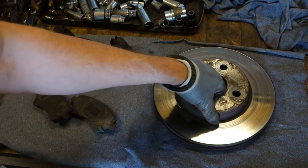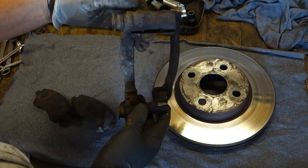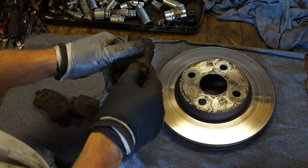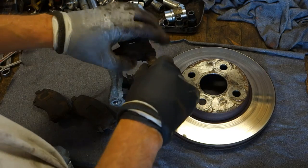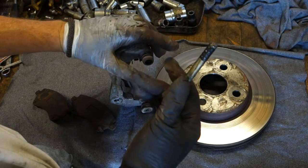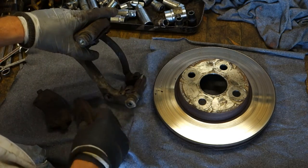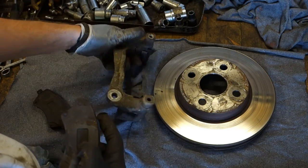And then when we look at that brake caliper holder, what was in that position, we need to first inspect how these support joints are moving, and they must move very smoothly. And if they are not, then we just pull out this bolt in here in that way, and we need to add grease on that part, and then we insert that back in here in that way.